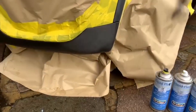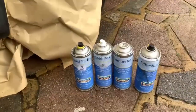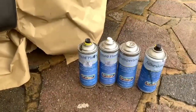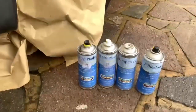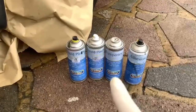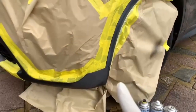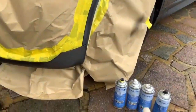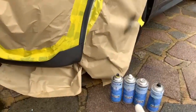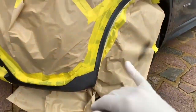These trims are finished with aerosols. What you can see down here is a dark grey aerosol colour. Obviously I know this is dark grey, but you can also get black, medium grey, and light grey. You've also got a texture application — you can get that in fine, medium coarseness, or very coarse — and also an adhesion promoter. That goes onto the raw plastic and basically helps the aerosol paint to stick to the panel. So we're going to go with the adhesion promoter first, then put the texture, which will replicate the textured finish of the trim, and then apply a dark grey over the top.